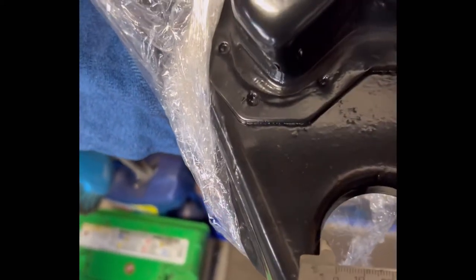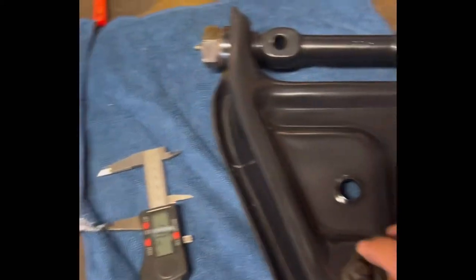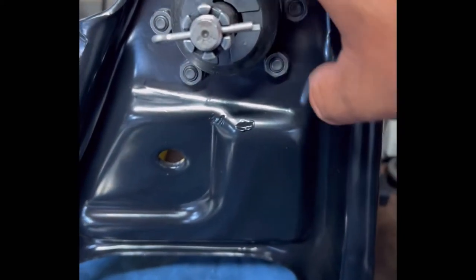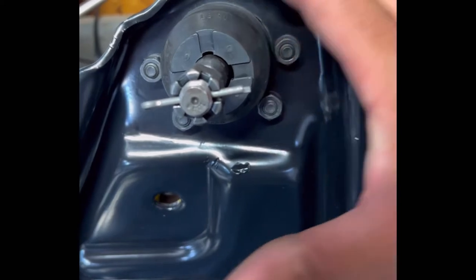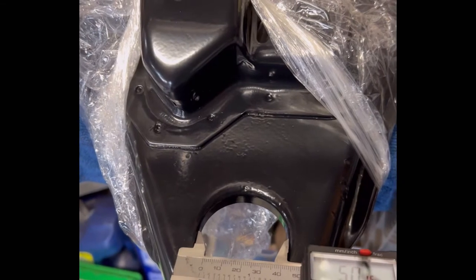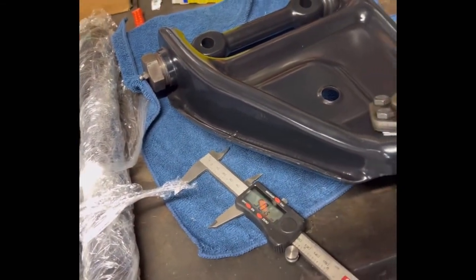If you go to fit it here, it doesn't fit. You have to widen it up, and also take into consideration the powder coat is kind of thick so I'm gonna clean that up. This top ball joint is a lot bigger — that's the only difference. The '73/'75 ball joints are a lot bigger, so what I had to do was grind that hole — pretty much just widen it up to get this ball joint to fit in there. Got that one done, but we've got to do the same thing to the bottom ones, not as much as the top.